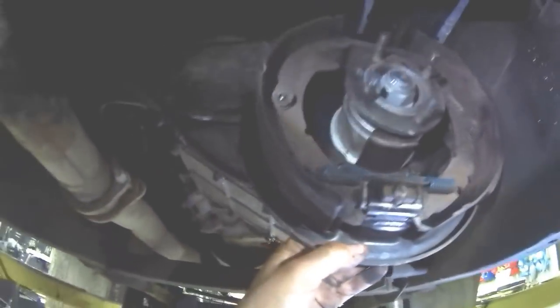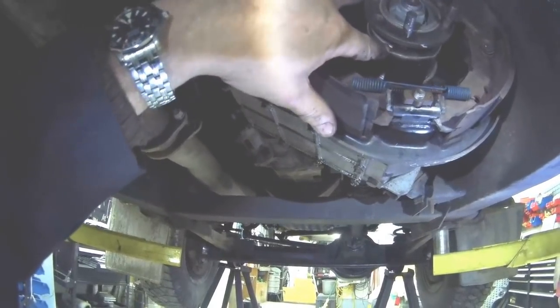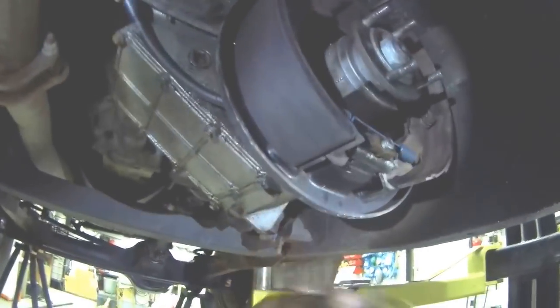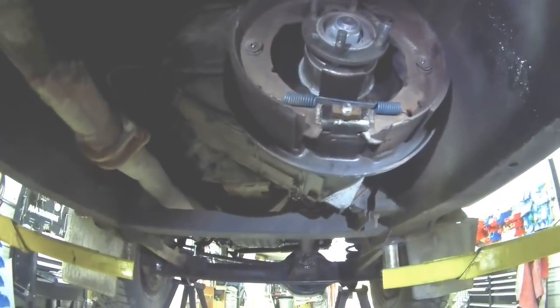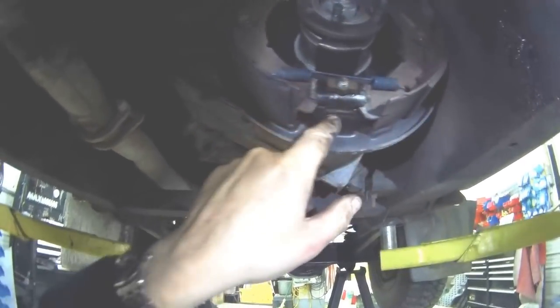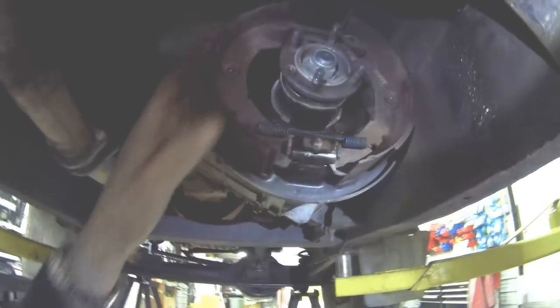Let's continue with this description of what these parts are. So there's your output flange, and you can see there's no oil dripping. This little piece of metal here is quite important — if the oil is going to leak out, it's supposed to go along this channel and then underneath and out through this hole here. This is obviously dry, so we know the seal's not leaking. But sometimes people have put transmission brakes together and forgot to put this bit in, and then if this does leak you'll get oil dripping onto your shoes. This is nice and dry.